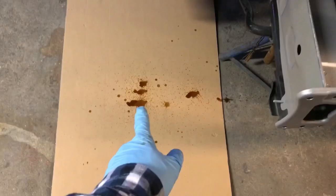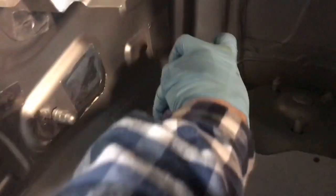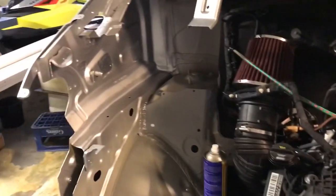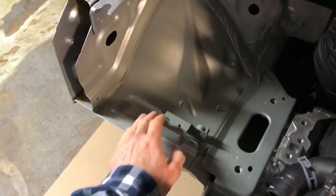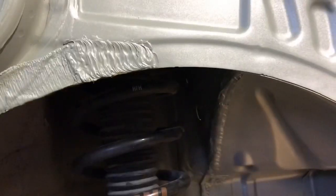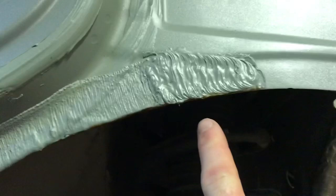It's now time for the special oil. There's nothing special about it — it's just this kind of oil you're gonna have inside after welding it together. The first one I use, you see the color is dark brown. I also have this one with clear. This I do on the top here because in the crack between the plates I welded, I'm going to let this one drift down between the crack, then dry it away on top. I get it also between there on the top. Now I'm done — clear oil all around this one. I dried away the outside stuff, also behind there I put a lot. So it should be safer now. You can see it's coming out in between in the cracks. That's how it should work — it's perfect.